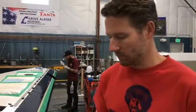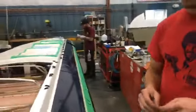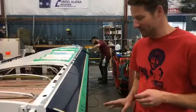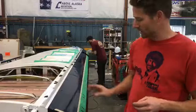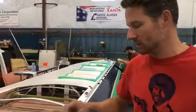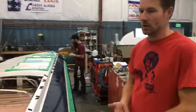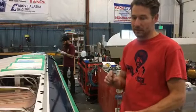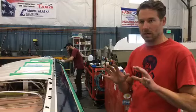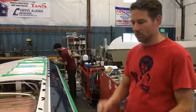What these guys do is they create a little vortex. As the air comes over the wing, it spins the air which re-injects the boundary layer. As the air is coming up on the wing, it spins and creates a little vortex at each one. This causes a re-injection of the airflow into the boundary layer on top of the surface of the wing. Ultimately, that slows down your stall speed, slightly increases your cruise speed, and probably most importantly it makes your stall a lot less aggressive — instead of breaking, it just gets mushy so you can still control the airplane.